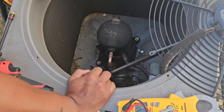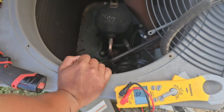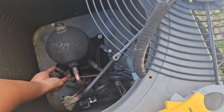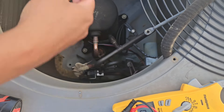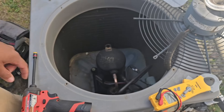No rub-outs on the inside of the unit, so as far as high voltage going to the compressor, nothing should have caused the problem there. We can put the plug back on — compressor is verified okay. Next thing we'll check is that old-looking capacitor.